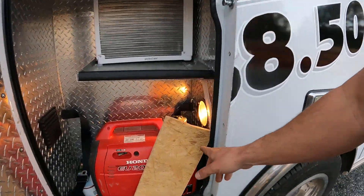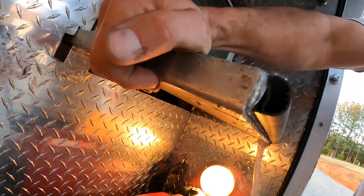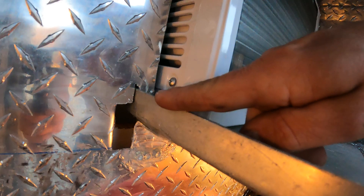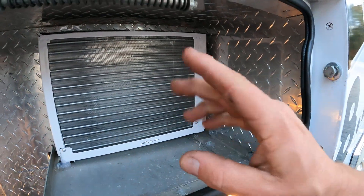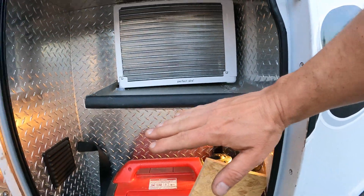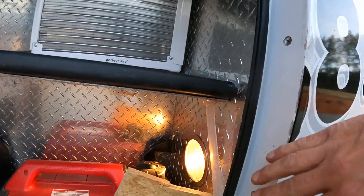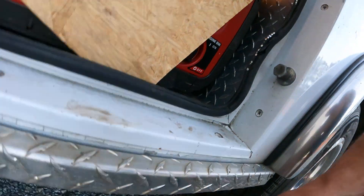It's still drying - I got a drip line right here drying. We put a custom tray. We had to cut through three layers: the diamond plate, aluminum diamond plate, two boards, two one-inch stick boards in there. I put a cheap 5000 BTU air conditioner and we have the tray slightly tilted on the angle this way, with a drip line right here going down through here and out.